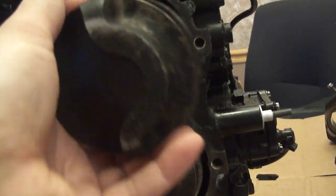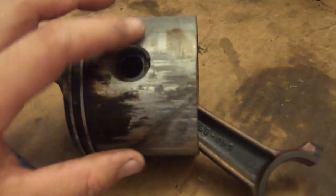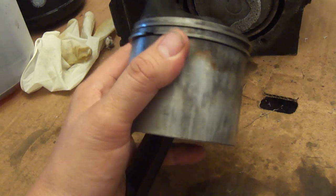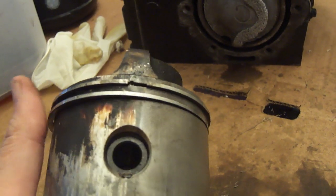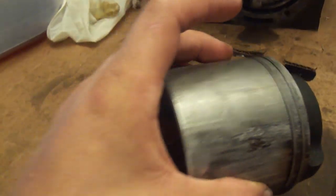The other two cylinders have a lot more marks. Some of this I can feel with my fingernail - right here it feels and looks like it's not wear on the piston but like metal deposited on the piston. But the rings look fine and I had good compression on these two middle cylinders. It's still round and there are no cracks.